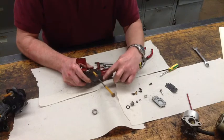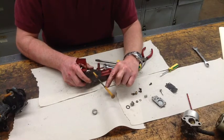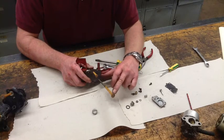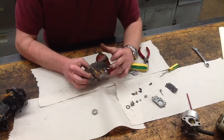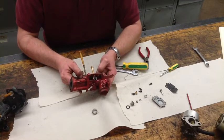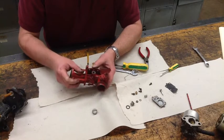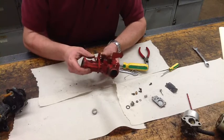On this style of carburetor, this brass tube is part of the carburetor — if it gets damaged, you have to replace the whole carburetor. These plastic portions can be replaced, but it's extremely difficult, requiring a lighter for a small amount of heat and precise pressing with a vice. At this point, this carburetor would be ready to go into the parts washer and be cleaned. Before putting it back together, blow through all the different passageways to make sure they're clear. As long as the diaphragm and all passageways are clear and there's no excessive wear at the throttle plate, this carburetor should work just fine.